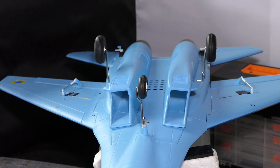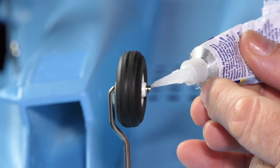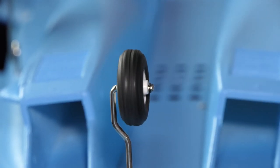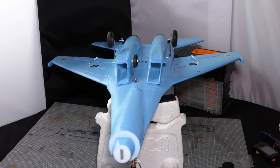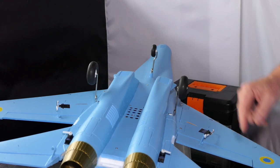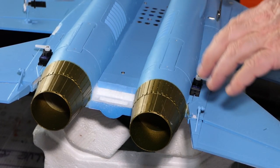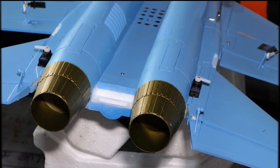I just need to put a drop of foam tack on these c-clips - just this side of the c-clip. It doesn't stop the wheel spinning but it stops the c-clip from accidentally popping off. I'm going to do that with the mains. All wheels spin freely and c-clips are secure. It would be remiss of me to stick those fins on without first having connected up the elevators, and also gluing on the tail cone that goes in the middle on the underside.